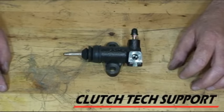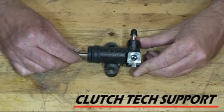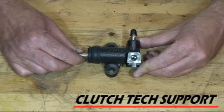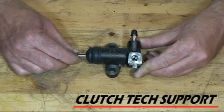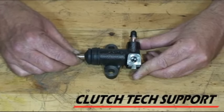Traditional bleeding: one person is at the pedal, they push on the pedal and hold it to the floor. In the installed state, this piston might be about there. As you push on the pedal, it moves slightly — it's pushing out against the fork and the bearing and the diaphragm spring. The pedal's on the floor. Now the command is to open the bleed screw. You open the bleed screw and the pressure in the slave cylinder is relaxed and the fork pushes back. You get this tiny little burp of fluid, maybe some air, coming out of the slave cylinder bleed screw. But what about the master cylinder? What's its contribution at this point? Just about nothing, because it was already on the floor and it didn't move after that. So all you did was get a little burp out of this slave cylinder as it relaxed from applying that pressure. Not very effective.